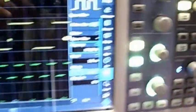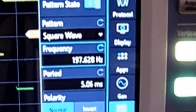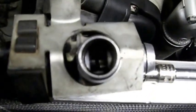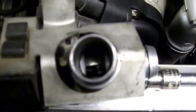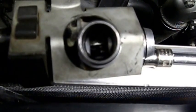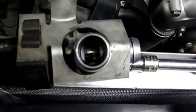One thing I want to show you is if I change the frequency used to modulate the valve and change it to almost 200 hertz, what happens when we change the duty cycle — you see sometimes when you switch the duty cycle it takes a very long time to settle back. Look how it goes, and then it slowly slides into position. That's not good, and so that's why they modulate the thing at about 75 hertz.